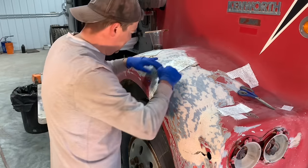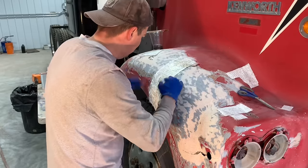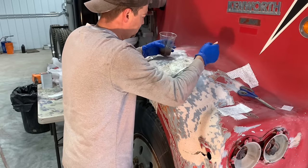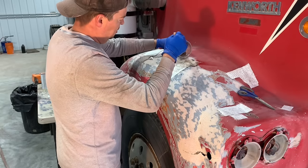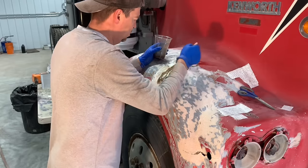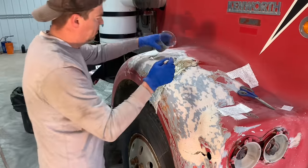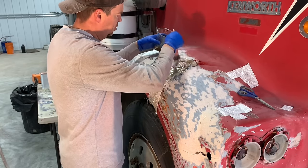That, and you can actually see the resin soaking through the mat in some places there where I really painted it in there thick. So that's looking good. And then rather than painting the resin, I find, because then it starts whipping out the fiberglass strands, so I just pour the resin on and I try and paint from the middle out. I find that works quite well.